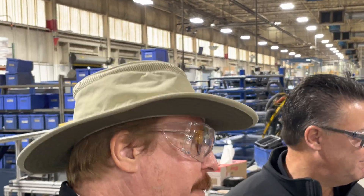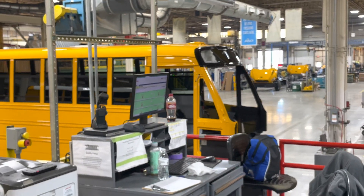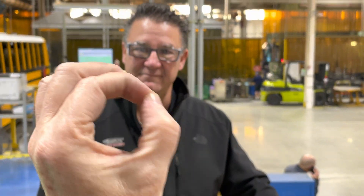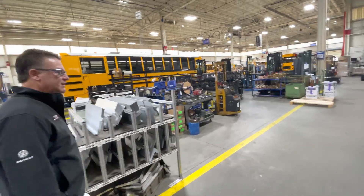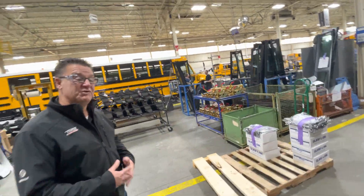When you see those seats, that's when it looks like a school bus. She's about done. As for waste — zero landfill per bus. They recycle all materials not used on the bus, or turn them into fuel and then into energy to produce electricity. Zero landfill is a mic drop moment, and that's a mantra with Daimler worldwide. These are the last finish stages where they put in either an air door or an electric door. There are also auto-reversing doors: if a student gets a backpack or anything caught in the door, it's load sensitive and will auto-reverse.